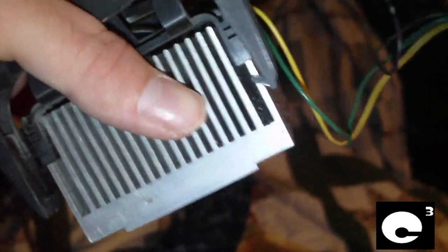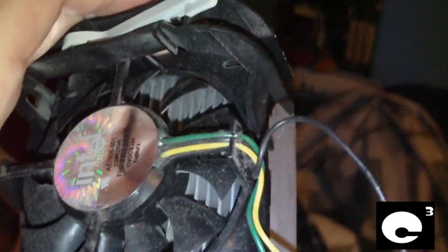And your CPU temp will climb. Here's this old basic Intel cooler. These aren't as bad as others in terms of clogging up with dust, but after a good bit of time these will clog up too. This one here is kind of clogged up in some areas. When these things clog up they can't get air through them, so it's crucial to keep them clean.